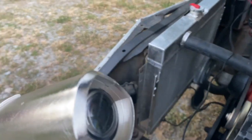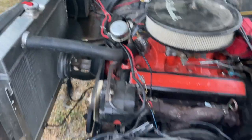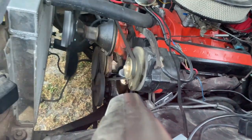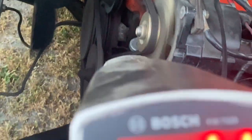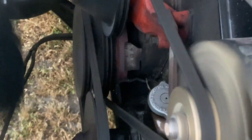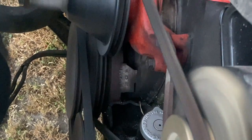You can see that's flashing — that's what you want. Be careful with the wires so they don't hit the fan. When you shine it on your harmonic balancer it'll flash whenever cylinder one fires. If we put this at zero it'll work like a normal timing light and you can count those little marks — in this case it's two degrees each, so two, four, six, eight degrees before top dead center.